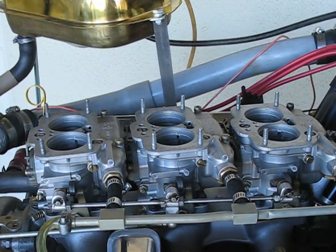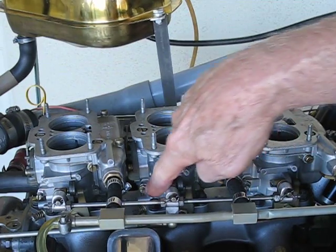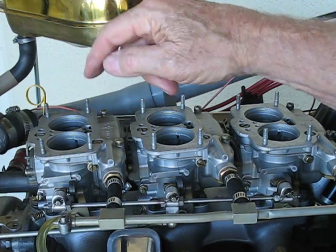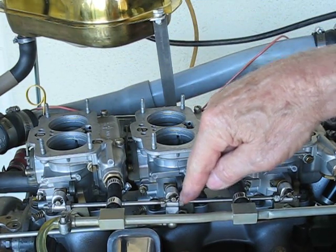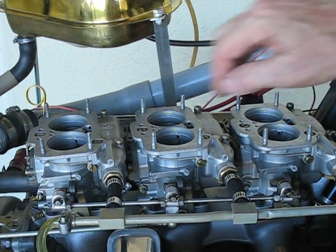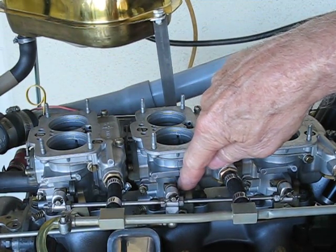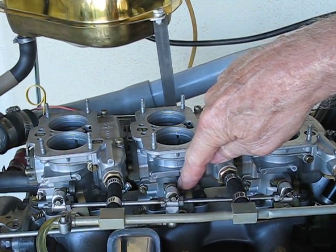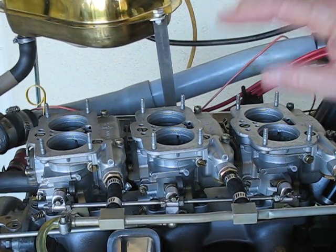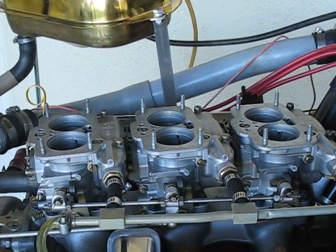And if you had to make an adjustment on those, you'd be using the air flow balance screws that are located down here on the side to balance from side to side on the throttle barrels. Then you'd make adjustments here with the linkage adjustments to balance from carburetor to carburetor to bring them all into number five. The center stop screw is the only idle stop screw that's used. The other stop screws are backed off and have no effect, or are not supposed to have any effect. It's only in the linkage that maintains the balance between the carburetors.